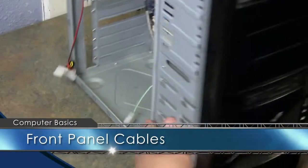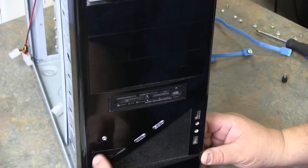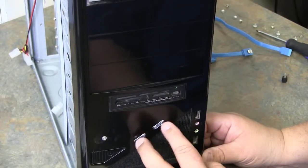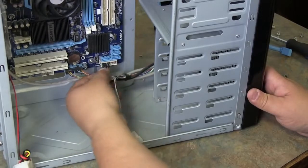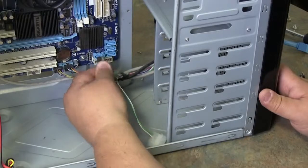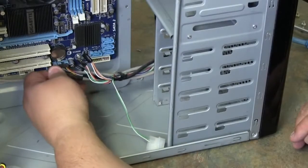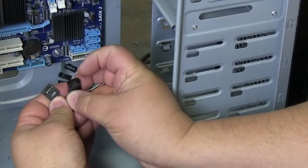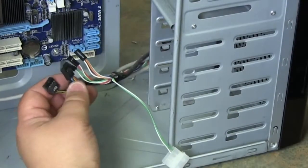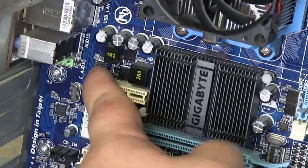Most of the cables you see here come from the front panel. The front panel has a card reader, USB ports, audio headphone jack, a power button, a power LED, and indicators for your hard drive and other lights. Disconnect those cables from your system board — don't pull too hard, just grab firmly and ease them out. Notice how they fan apart. For USB cables, grab lightly and pull — these don't fan apart and have 'USB' printed on them. There's also the audio cable — pull from here, and the system board will indicate where it says 'audio.'